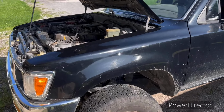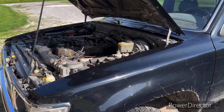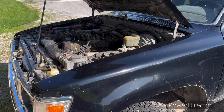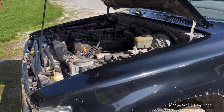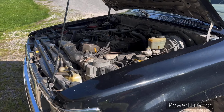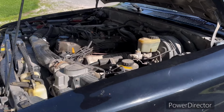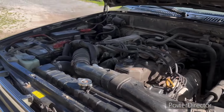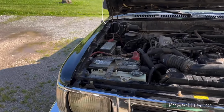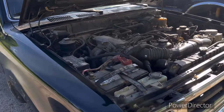So I've got a couple of pictures I'll probably post up right in this area somewhere to show you what it looked like. I went through, had a lot of work done on the head, cleaned everything up. I cheated a little bit. We honed the cylinders, I re-ringed it, and used the stock pistons back, gave it a good cleanup. Put a clutch in it, put a crank in it, bearings. Basically went from the clutch to the radiator cap.